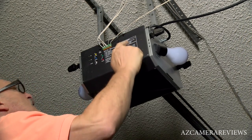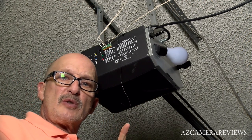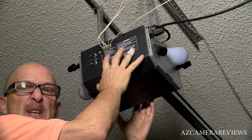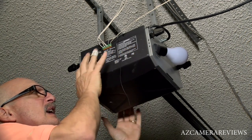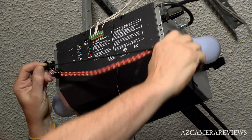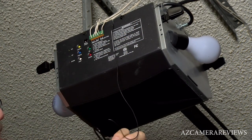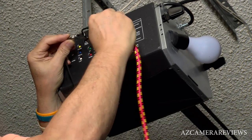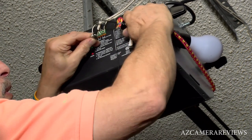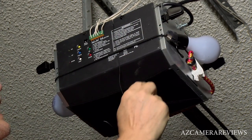On the top side of this there are two screws here, two screws here, two screws here, and then two screws on the back. But before you remove those screws, what you want to do is rubber band this together so the whole thing doesn't come apart — it's basically four pieces. I have two bungee cords, one thin black one and one red one. I'm going to put them together and reach around the back side of the unit, hooking both bungee cords together so they put pressure on the box and it won't fall apart.